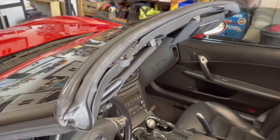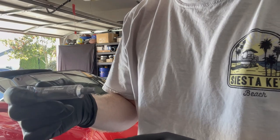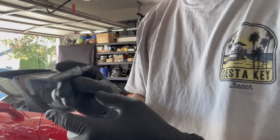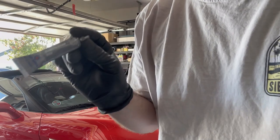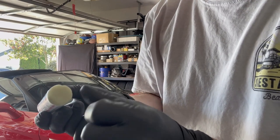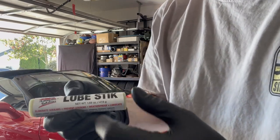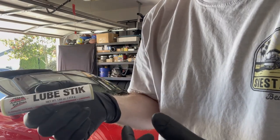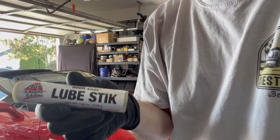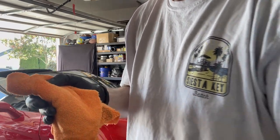A couple of the things you're going to use: dielectric grease — I always have a small tube around, it goes a long way, good for anything electrical like coil packs or spark plug boots. Good stuff to always have in the garage. I also picked up a lube stick, which is sort of a waxy, greasy compound that shouldn't leave weird residue — you just need a little bit. It's great for wooden doors that rub and creak, rubber door seals, and things like that. I'm using a damp microfiber cloth to wipe everything down first.